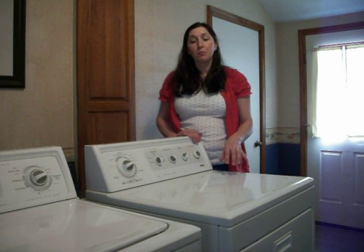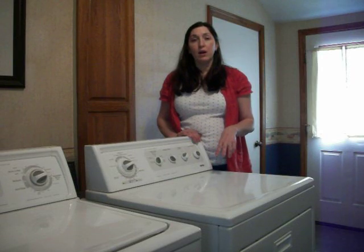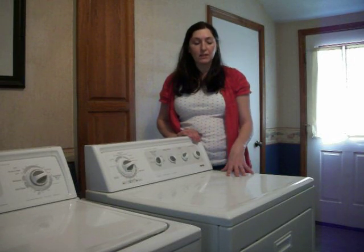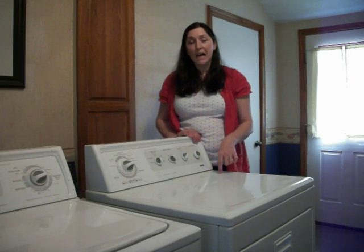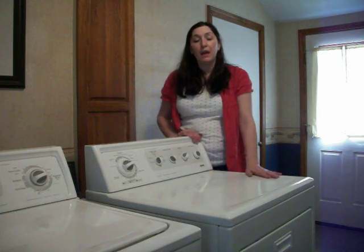There are three to four different fuses inside of your dryer. Two of them run to heat, to tell it to get to a certain temperature and to not go above that — it's a high limit and a low limit thermostat. And then there is a safety cutoff fuse that will blow if it's totally blocked, and it cannot be reset. None of these fuses can be reset.